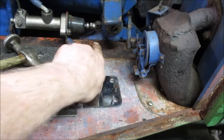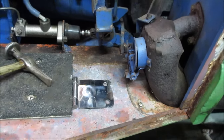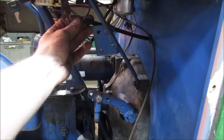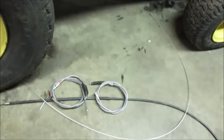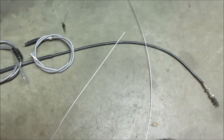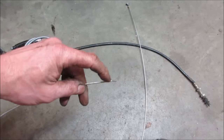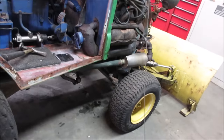So we have to pull on the cable when this goes down. I don't know if we come out with a rod here and a cable that expands. How else can we do that? That's really about it, right? So we got this jacket we'll probably leave in place, and maybe we'll try to run a new cable through it if we got room. And I grabbed a stash of different things. Maybe we can use this one on the end that's on the carburetor. It has a barrel that tightens down to just raw cable. It does not need to have any kind of end on it. So I don't know if we need that or not. Hopefully that'll be long enough.